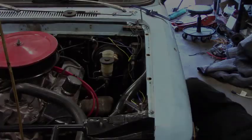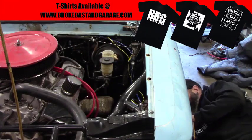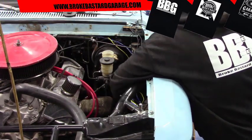Now that it's all plumbed out, all we have left to do is bleed the brakes. You can see the proper way to install the line lock - after the proportional valve: master, proportional valve, line lock. Yes, it takes a few more lines and some time, but the brakes are going to work properly. I'm not going to run out the back of the track, smash the truck, or get hurt.